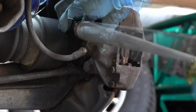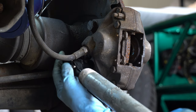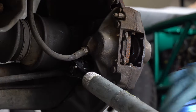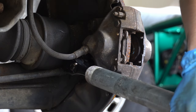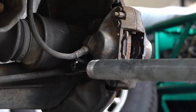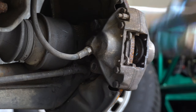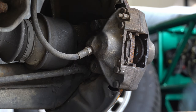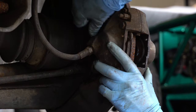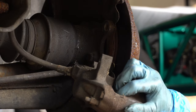My light! With the light back in a semi-functional place, I attach to the bottom bolt. Just kidding — if it happened again I was gonna throw it across the garage. With that out of the way, now I can very carefully loosen this bottom bolt. After dozens of tiny wrenches, it's ready to come out. Now I'm glad I remembered this before I took off the top bolt — you're definitely gonna want to have a box or something you can prop the caliper on so it's not just hanging off by that brake line. Remove that top bolt and let it rest. Its watch has ended. Thank you for your hard work over the years, you sketchy, sketchy caliper.